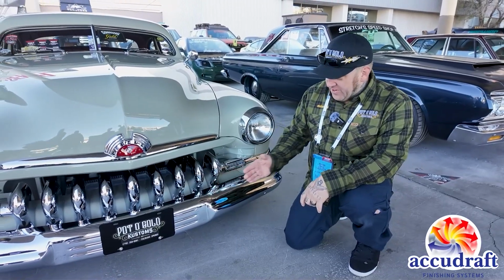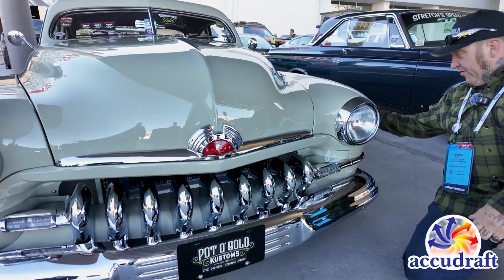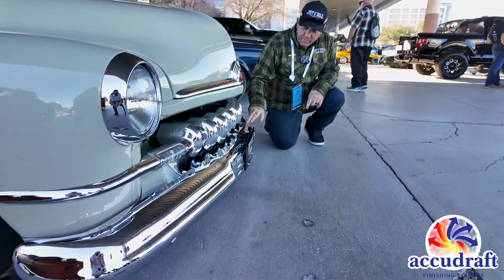With the bumper, we tucked it in until we just covered the teeth, and then we cut the cap off and brought it forward to match the wheel well arch. We shaved the overrider off of this as well and removed the bolt holes from that too.